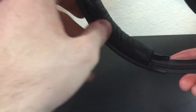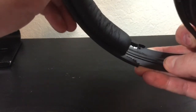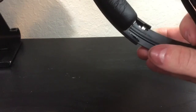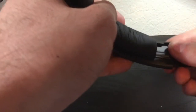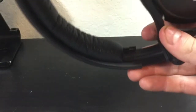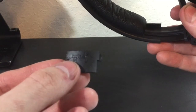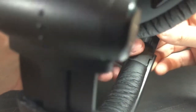I was really careful, and it takes a minute to get that little metal piece back into place. Just make sure it kind of points up in the middle where it latches on — that's the point you want facing towards the little grooves inside the headband. When you take it apart, you'll see what I mean. If you try to put this together and it doesn't make that clicking sound, it's not positioned right. Take the metal piece out, wiggle it around, make sure it's flush with the track of the headset.